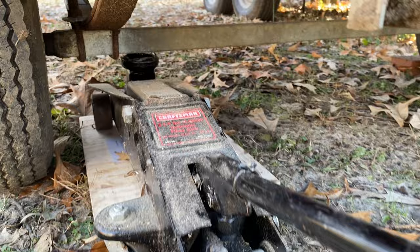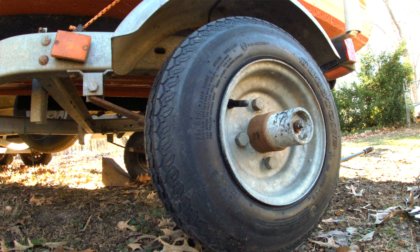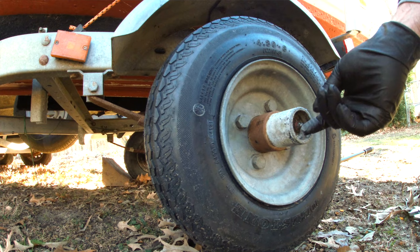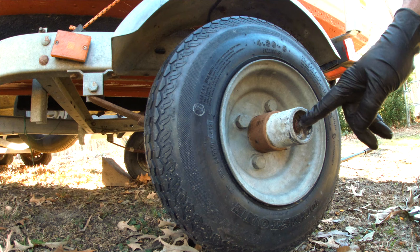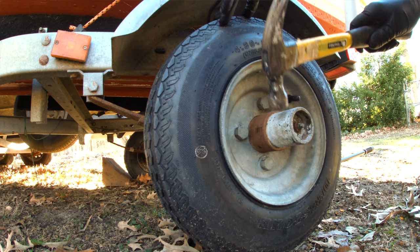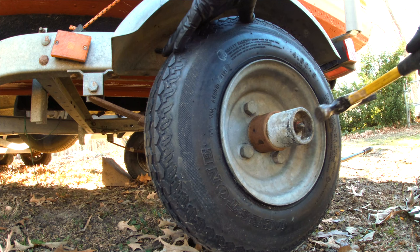One of the first things you want to do is jack up that side of the trailer. Once you've got it jacked up and the wheel off the ground, you're able to take everything off. These things come off as the whole assembly, so you don't actually have to take the tire or the rim off of the hub — you can take it all off together. Mine has a center grease fitting cover for the hub, like a bearing buddy or other type of device, which squirts grease into the wheel hub. Whatever the center cap is, it has to be removed to get to the center nut that holds the whole wheel onto the axle.